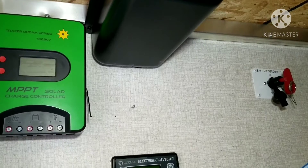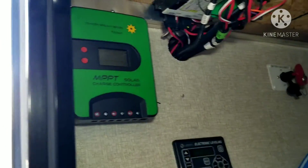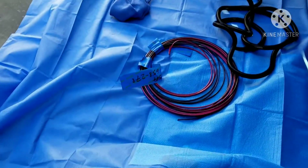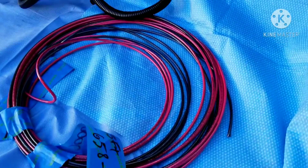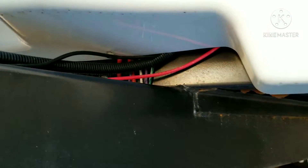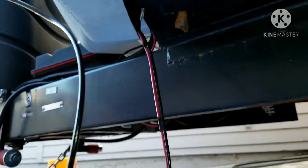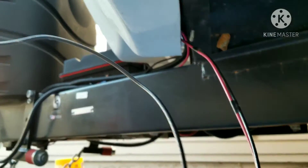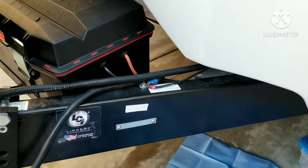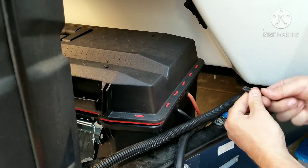You can see the little black box — we're gonna take that off. As you can see, there's already a hole right there for my wires to go into, so now I just gotta feed them down in front of the fiberglass cap. What I picked up from Home Depot is 10-gauge braided copper wire, because I'm also going to use that for my solar panels when I do an extension. I grabbed some plastic wire loom as well, just to give it a clean look and to protect the wires from vibrating and bouncing around against metal, so it doesn't wear out the insulation sheath.